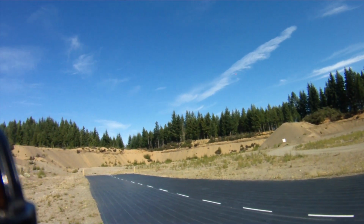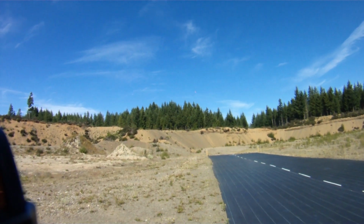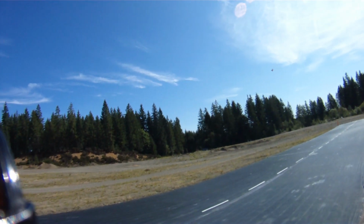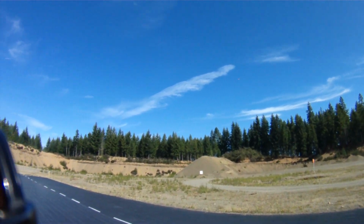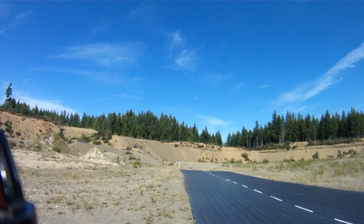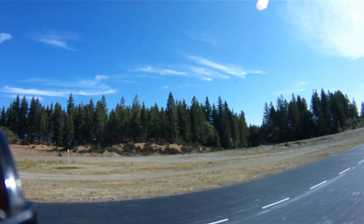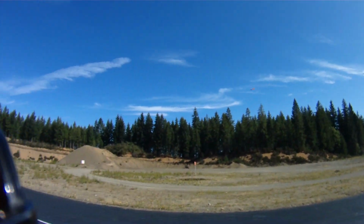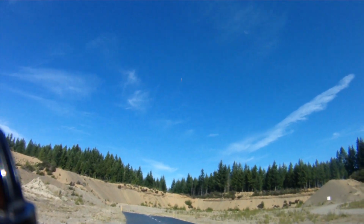You know, right from the ground up, take a 5-inch 3-bladed quad prop. So it's not the fastest plane in my hangar, but definitely the fastest F-18 version 3 I've ever built, and very, very agile. I moved the motor forward by 30 millimeters, and so everything's really tight around the CG.